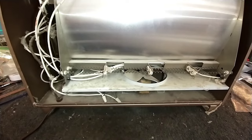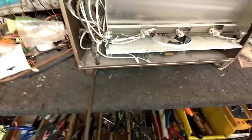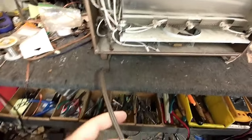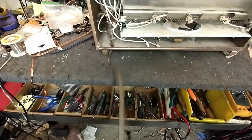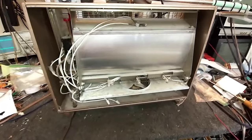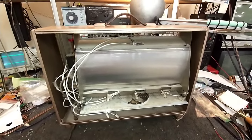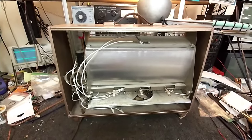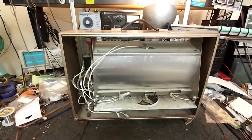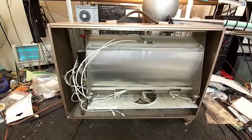We're going to oil up the fan motor and see about replacing this cord. The reason I'm replacing it — even though it still looks good and is very supple — is that it doesn't pass the heat test. When I turn the machine on low and let it run for five minutes, portions of the cord get significantly warmer than the others, which indicates broken strands inside. There's loss, and it could become a potential fire hazard on high settings when that cord gets hot enough to melt.